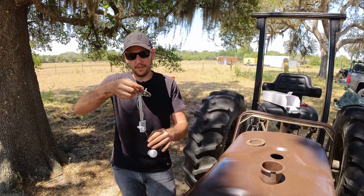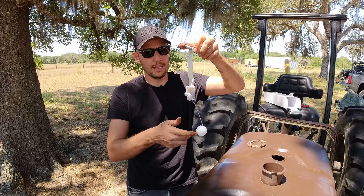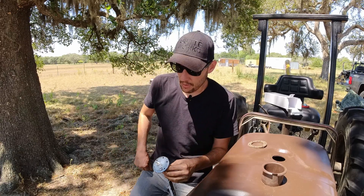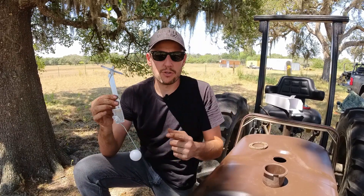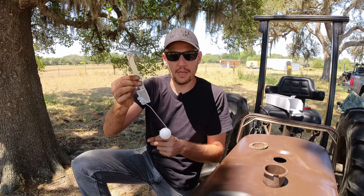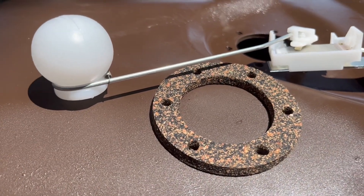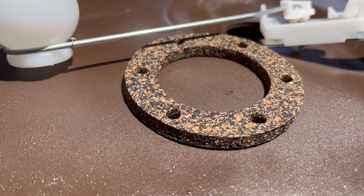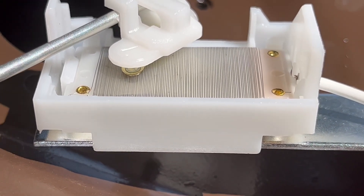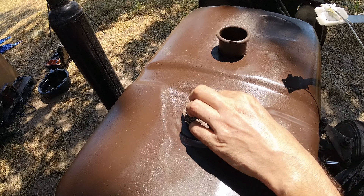Here's the fuel sender. Now this sender isn't the highest quality, but the way it works: there is a resistor right here measuring 430 ohms in one position and 33 ohms in the other. You need to make sure the gauge in your dashboard matches that range — because some gauges measure 430 ohms as empty and 33 as full, and others do it the opposite way around, so make sure you don't get it reversed. This sending unit comes with a very nice gasket, a cork gasket, the float, and the measuring mechanism — a coil and a contact. Depending on where the contact is on the coil, it measures a bigger or smaller resistance.